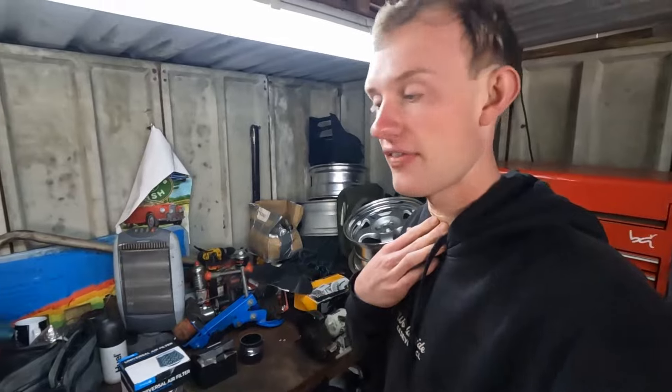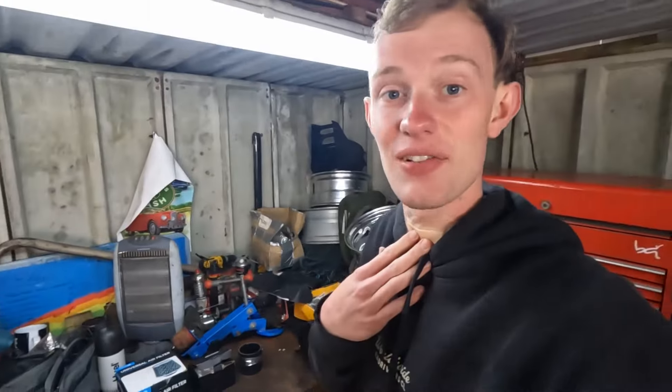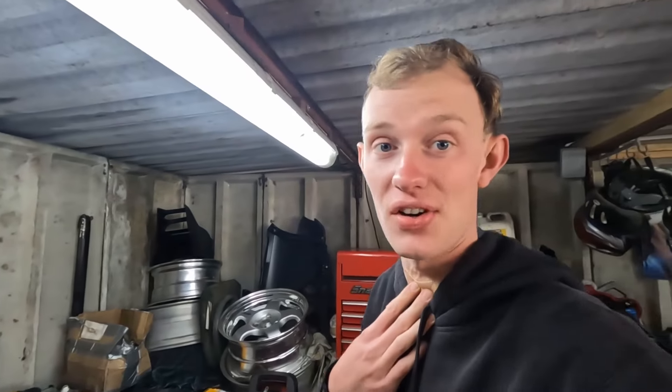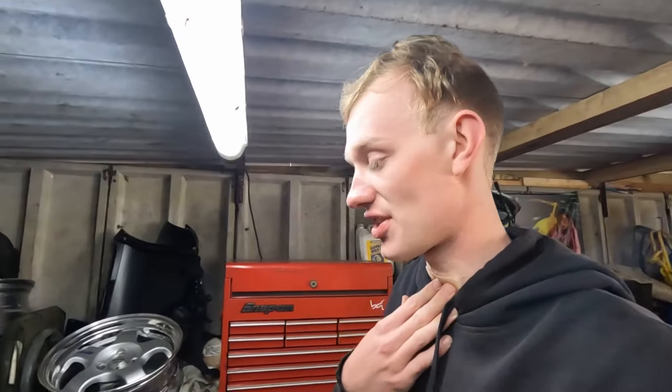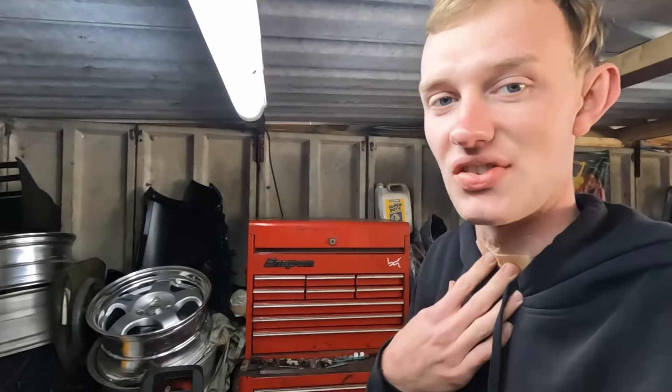Let's get the old air box removed. Here's everything I'm hoping I'll need: we've got an air filter - yes, laugh at me, it's a Halfords air filter, cheap and cheerful and you won't see it where it's going, so I don't care. We've got a MAF housing which I didn't buy, I got that off the original owner. And we've got a piece of silicone tube, 76 millimetre, to match the throttle body and the MAF housing. Now let's have a bit of an unboxing.